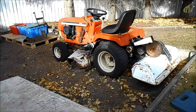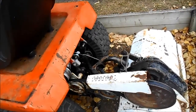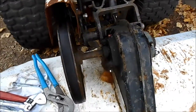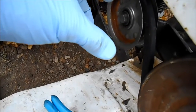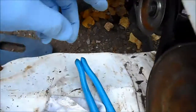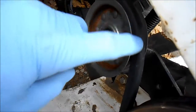Okay, I call that a success. Well, I'm just going to service this tractor now. I did get this belt on properly, but I don't know if you can see that this pulley right here is at a bit of an angle. So I actually put a washer in behind — two washers — to move the pulley this way, because I noticed that the edge of the belt just got roughed up a little bit, and I think it's from this edge of the pulley here.